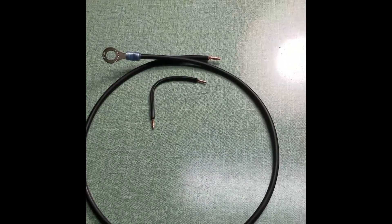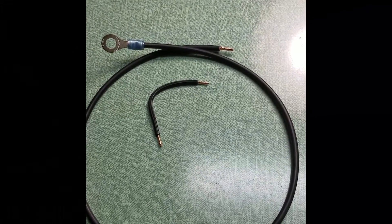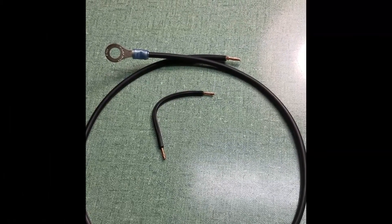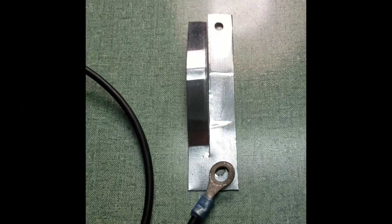You also need to create these two wires. The short one will be to jump the ABS so that you won't get an ABS light — you'll connect that into the yellow harness at pin number four and pin number six. For the longer wire, this end goes to pin number one on the yellow harness, and this end will connect here. Here's the custom metal piece for the horn — this line goes down and connects to the yellow harness at pin number one.